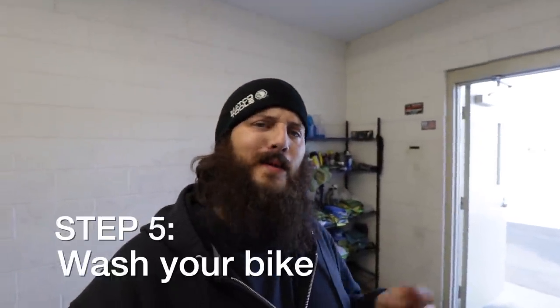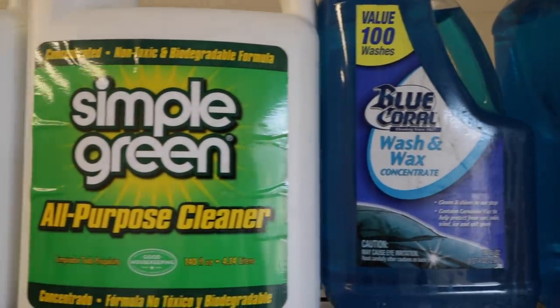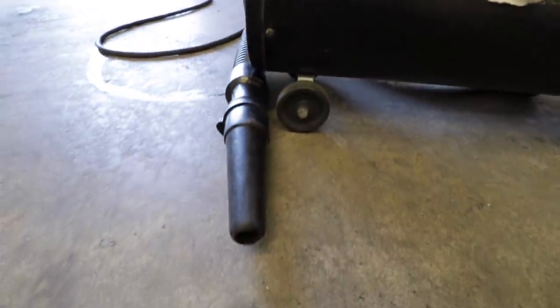Wash bay! Maybe you could do this step before you do the battery — either way, just make sure you're getting all the residual oil around that oil filter off of there. Get the bug guts, get the road grime from the season. Get all that off with whatever chemical you use — we use a lot of Simple Green on the oily stuff. Use a leaf blower or a motorcycle-specific air dryer to get all the water off; you don't want to leave that sitting on all your nice chrome. Then throw some wax on it — it'll be a lot easier to get the dust that settles over the next couple months off if you've got some wax on there. Protect that paint, keep your bike looking good, and you're just one step closer to being able to ride again in the spring.